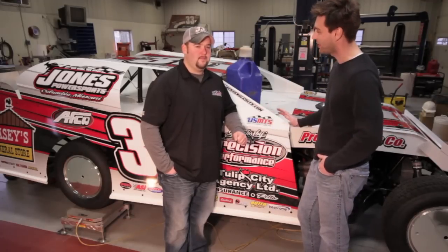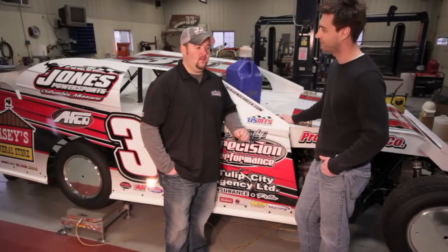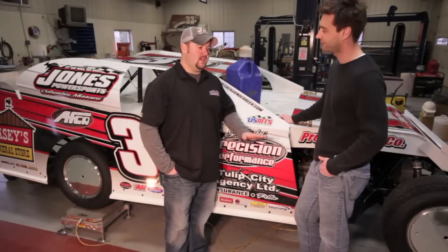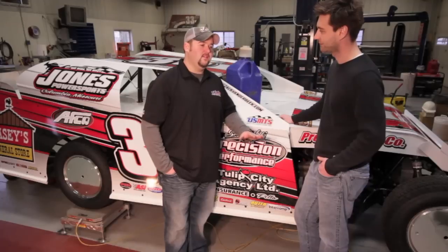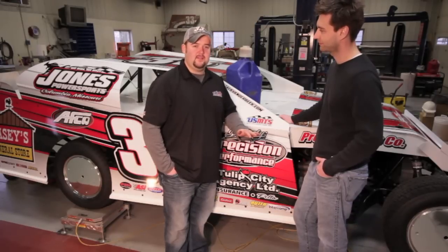Zach, now that we know where the numbers are at in the car, what is the first thing we have to do to get this baby scaled and ready to go? Well, we review the numbers and see where things are at, but that doesn't tell me a whole lot until I know that my ride heights are correct. That's one of the first things I do — make sure those are right. Not only for having a consistent baseline every time you scale, but ride heights are also a key part of weight transfer and getting the balance right on the race car.